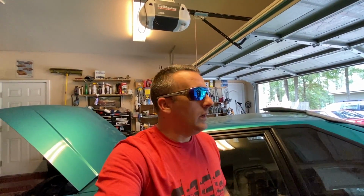Let me give you an update on Cliff's car. Cliff called me and said, man, the car is just not performing right. It doesn't seem to have the power that it did have. What we think it is is the timing. Before, when we worked on it the first time, we had to bump the timing up on the car to get it to run right because the idle air control wasn't working. So we kind of compensated a little bit. Well, when he brought the car back, we got the idle air control working, and we lowered the timing to like 12 degrees. He says the car's an absolute dog.